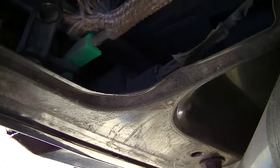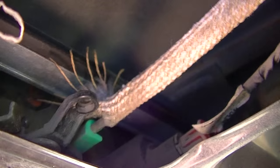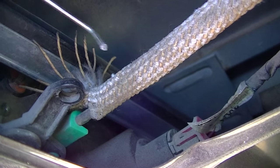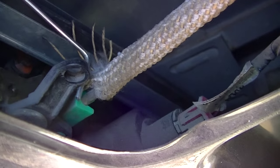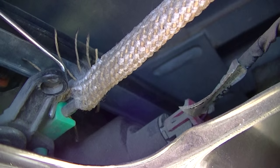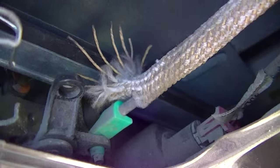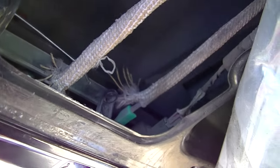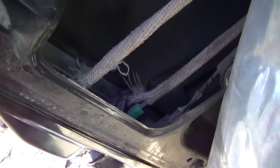There's my hanger — jiggle it around, twist it around till I get under it, pull up. The door's unlocked. Lock it again — there, it's locked. Obviously this can be a lot harder to do from the outside, not knowing where you're going. I can see where I've got to move my hanger and pull up — unlocked. It does work, but every car is going to be different.